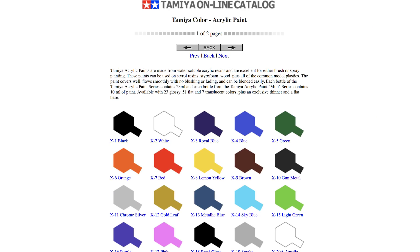There are three options for matching paint. The cheapest is to go to your local DIY shop with a close-up photograph of the paint finish and ask them to mix up a matching sample — these are either free or very cheap. You can then fill the chip and cover it with epoxy or nail varnish, then rub smooth with wet and dry. Another option is a model shop — look for paints by brands like Tamiya, who specialise in radio-controlled cars and models, with huge ranges of enamel and acrylic paints that should give you an excellent match. Finally, a car sprayer can certainly match your paint, but they're more expensive, so speak to your bike shop or manufacturer first.